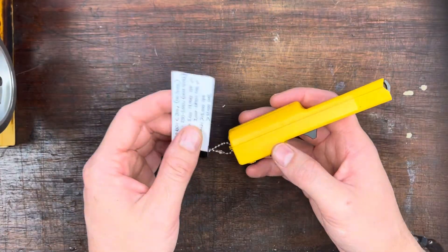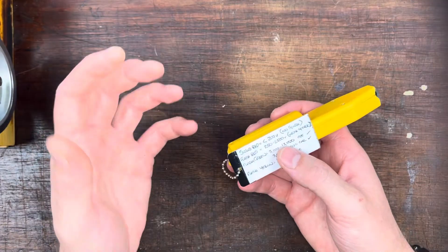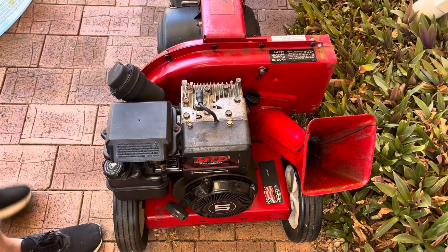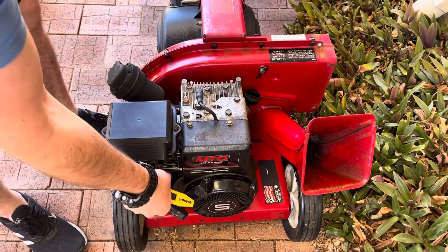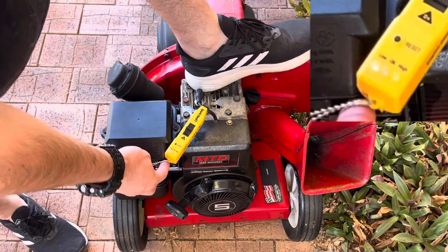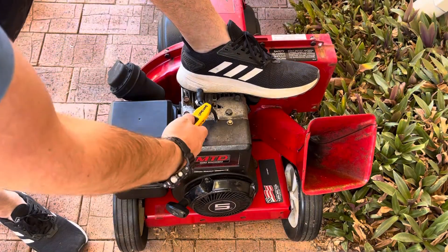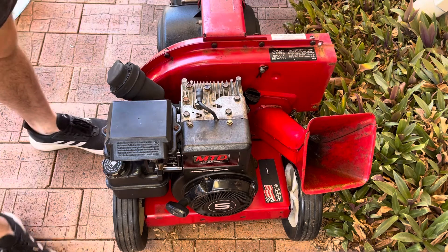One really useful thing is it will tell you whether you've got problems with the resistor inside the spark plug — I'll go into more detail on that when we go outside. Here we have a chip shredder. Make sure we've got the kill switch off, hook it on. Red means it's ready to go — give it a pull. Straight onto green, I've got good spark. I don't have to fiddle around, unhook, unplug, check, and struggle to see a spark.